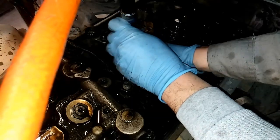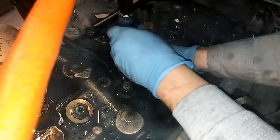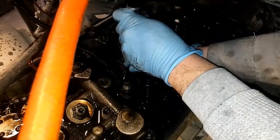If you can hear air leaking out of your exhaust, you know you have a bad exhaust valve. If you can hear air leaking out of your intake, then you know you have a bad intake valve.